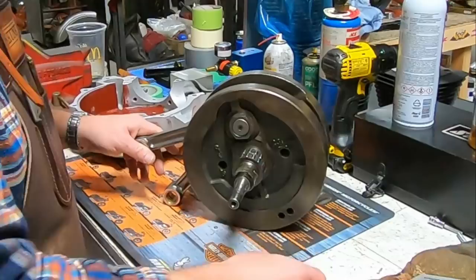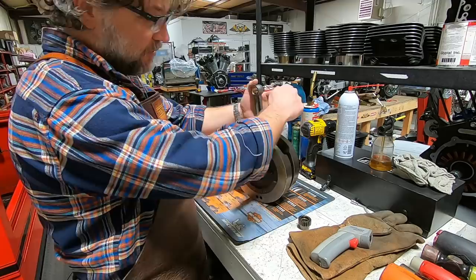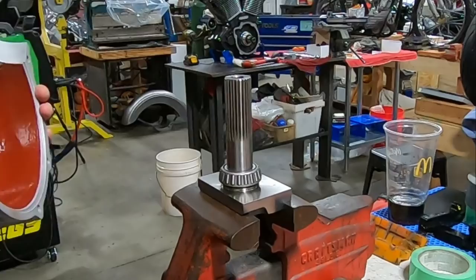All right. Now, as I said, this is not a hot rod build. So what we're starting with here is a stock Evo set of wheels, and the rods themselves are actually reproduction rods from Ted's Cycle. You'll notice these bearings are already in place. It was done to check the clearances after honing the bearing race there, and we've got those sized up perfectly.